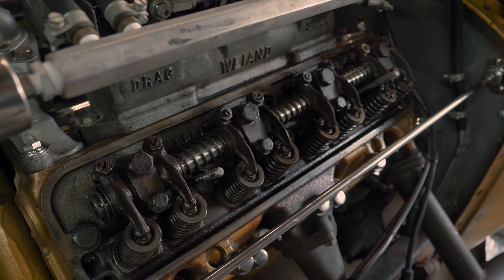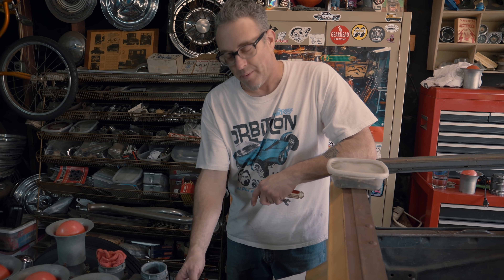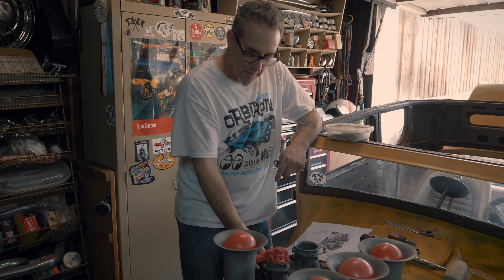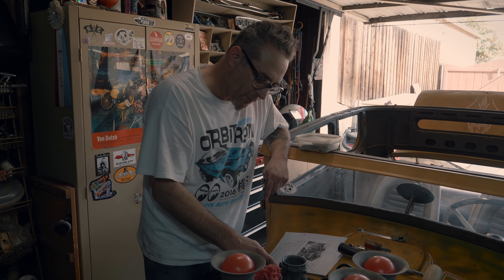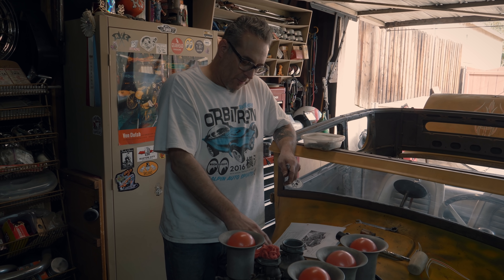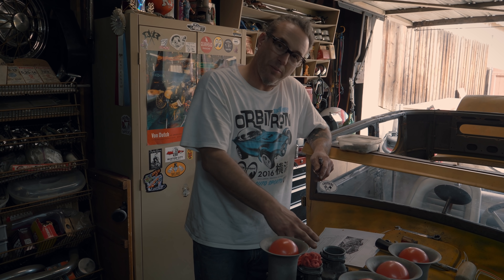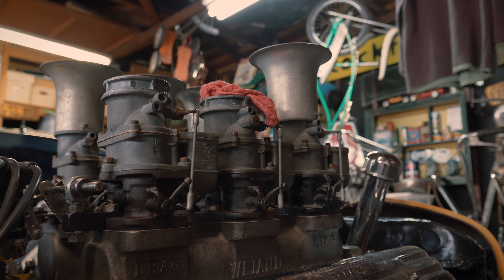We need to get a new valve cover gasket. I noticed a little bit of water below the carburetor — this is a six-two setup with the Stromberg 48 carburetors, but it's not running all of them. I decided to take one off and when I looked through the top it looked okay, but then I noticed there was a little bit of water inside. I took the whole thing apart and there was actually a bunch of water stuck inside the carburetor — it was leaking into the manifold. I'm thinking the coolant I saw on this side of the engine was coming from this. Now I'm checking all the linkage and making sure all the carburetors are tight, then I'm going to take off the other rear carb and see if that has water in it too.